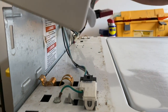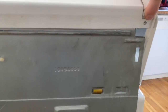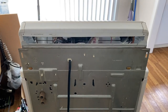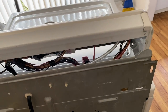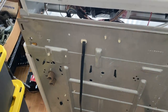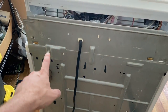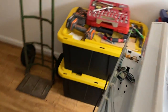Now we've got the whole top piece off. This is the reason why we took the two screws on the back side — we took this one off and this one off, so now when we bring this up it can come out. I've gone around and figured out that there is no way to take the top part off or the front part off like my Hotpoint. So it looks like the access is strictly here in the back. I watched some other videos trying to figure out how to get in here, but there are zero videos on this specific kind — it's the Continental Commercial Automatic Water Level, so apparently this one is put together differently.